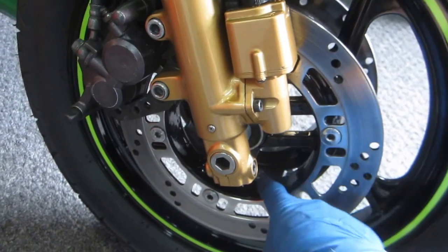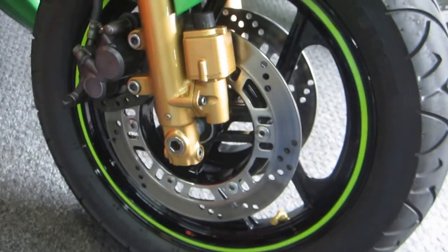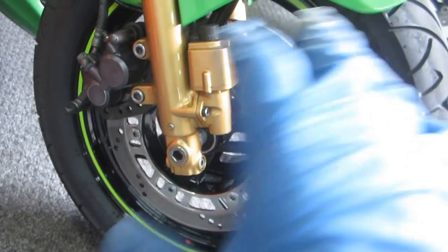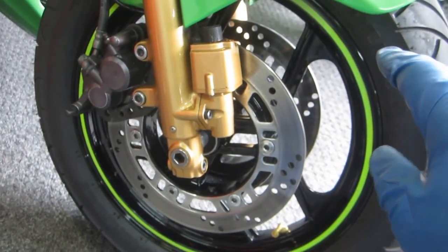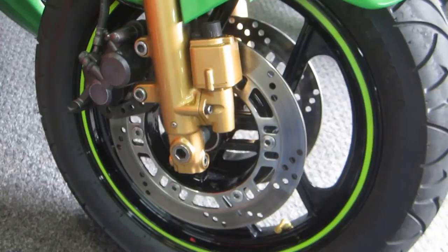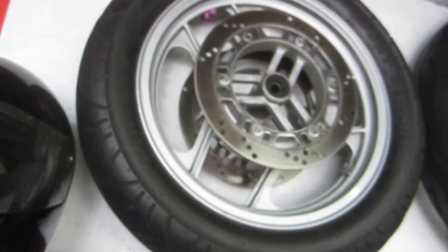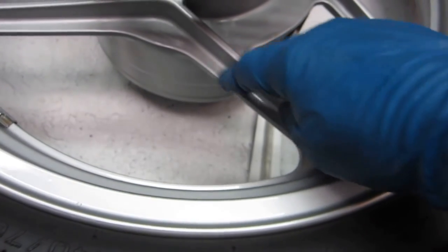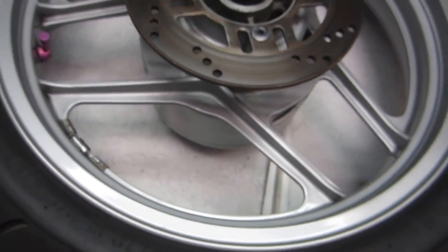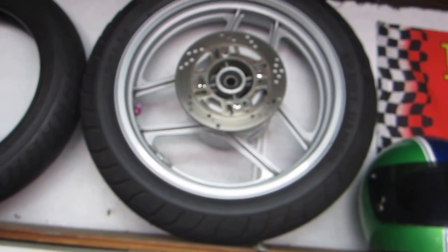This is what I was saying — this is going to show in here, the way Kawasaki makes the wheels. Every sport bike is just a little bit different, but these wheels aren't that dissimilar. What Glenn is going to have is the whole wheel in green and the stripe in that metallic blue, which should accent it pretty nicely. Now this is the spare set of wheels I have for the 750. The reason I wanted to show it is there are all of these areas where they're cast — you can almost not think it's a casting — and that was from sanding the coats of primer one by one, just filling it all in, getting it all smooth. And it really did make a nice difference.